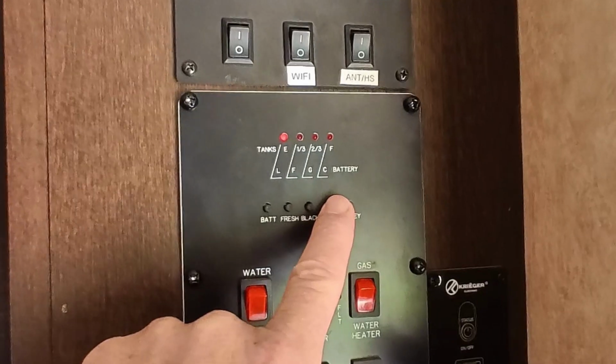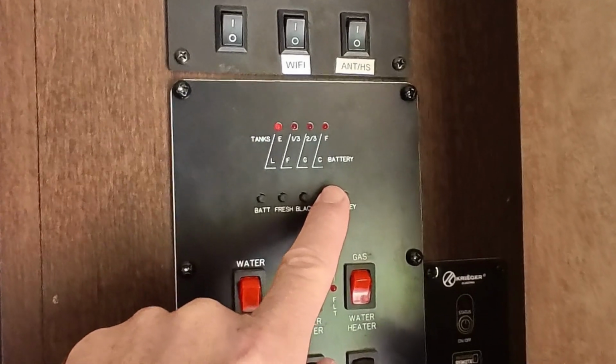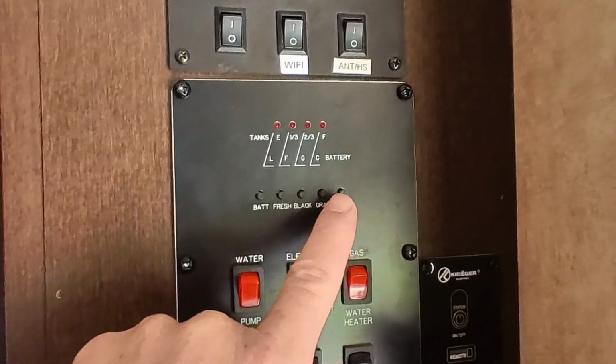If you have a KIB tank sensor system in your RV, you'll know that they're not that accurate to begin with, and you only get the 1/3, 2/3 full readings. My problem began when we would go out camping just for the weekends, and I would get 5 gallons worth of water in the tank, and it would show that it's 2/3 full. Looking at the Forest River website and downloading the spec sheet to see what my RV is capable of, it shows that I have 75 gallons worth of capacity for gray water. So I needed to find out what was wrong.